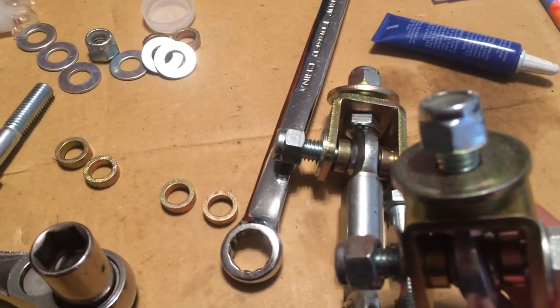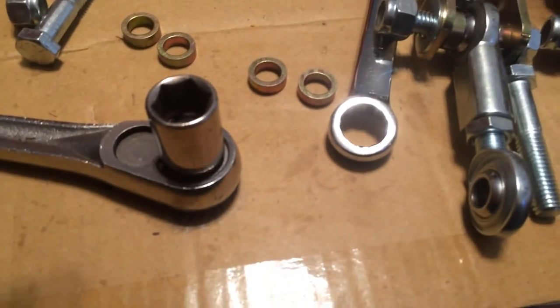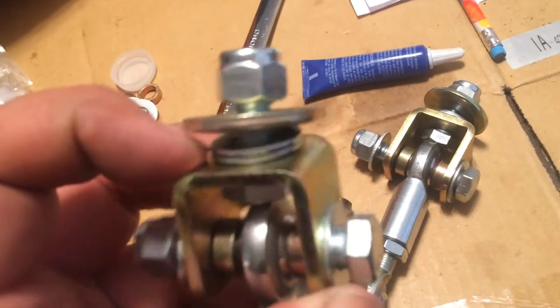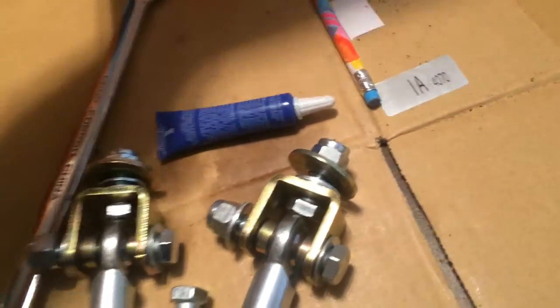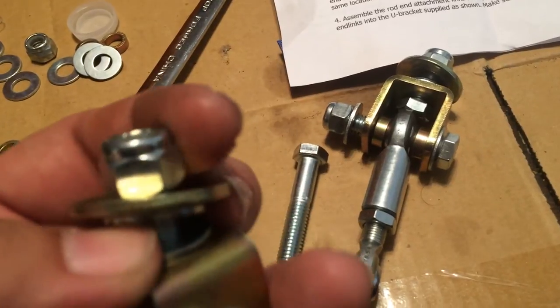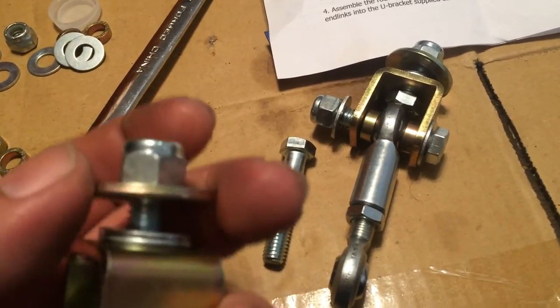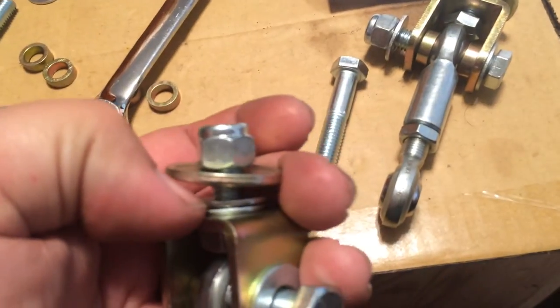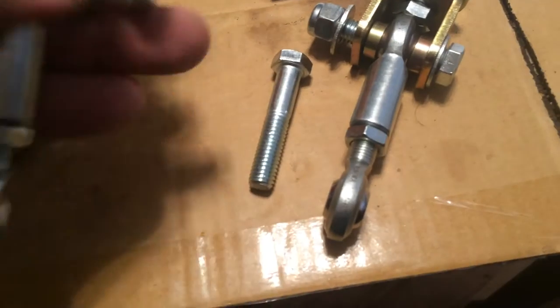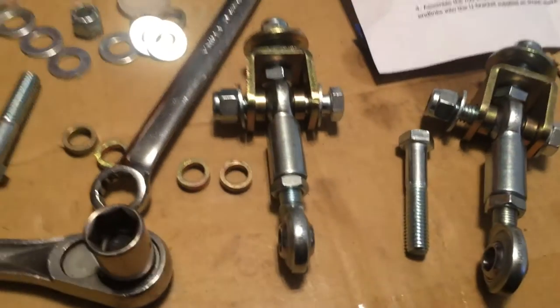But, I seen on the forum, I don't remember which one, the guy that installed his, he said that the top here, the bracket, didn't sit very well in the control arm, because I have the OEM control arms, and as you can see in this picture, it even shows how it's cocked to the side, and he said that it didn't seem very stable, so he added a washer on top of it, and he said it made a big difference. And also on the top of the control arm where the end link bolt will go, there's like a cup, and this washer was sitting directly on top of that, and he had thrown in another washer on top of that one to take up the space more or less, and make it more solid. So I'm gonna take his advice and see how that works out.